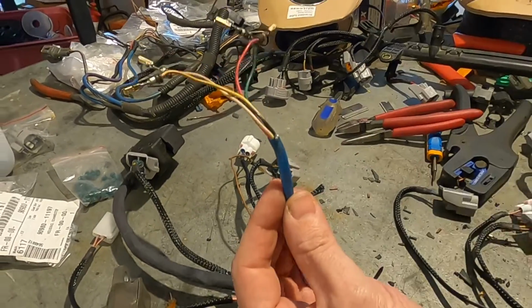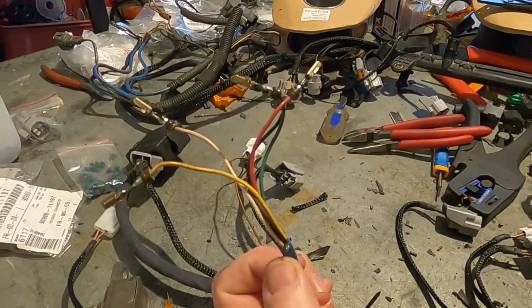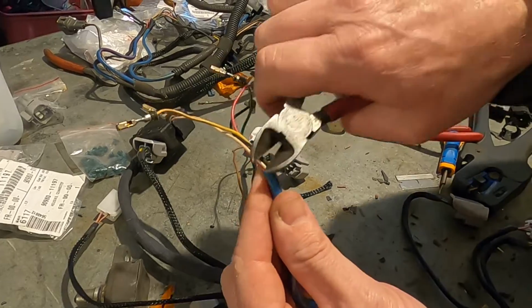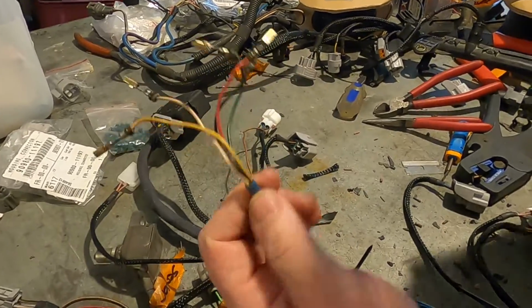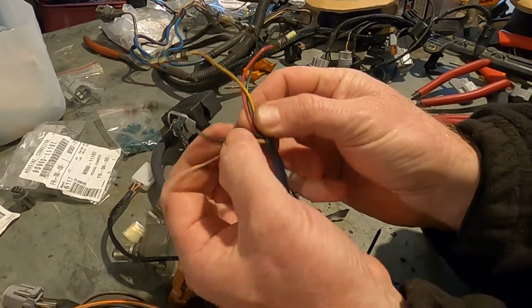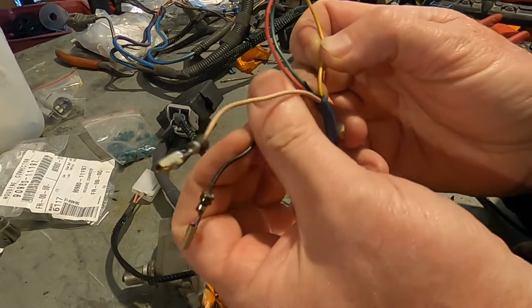In some applications, I've seen it on stereos, you have to actually ground that shielding. The shielding itself has to be grounded. You only ground it at one end. So it must be grounded at one end. I was looking at the stereo in that particular case. Ground it on both ends, you might make a transformer.